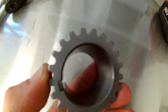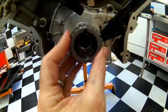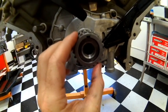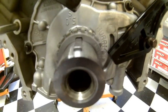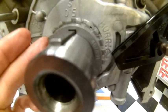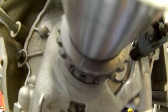The next thing you're going to need to do is locate the lower crankshaft gear. There's a timing mark on it that needs to be noted — that should always face out. Go ahead and install the timing gear by simply sliding it over the crankshaft. This particular gear is one of the MMR billet crankshaft gears. These gears are known to fail in the factory application, so any performance application should definitely use one of these. Once installed, the timing mark sits down towards the bottom at about the 7 o'clock position.